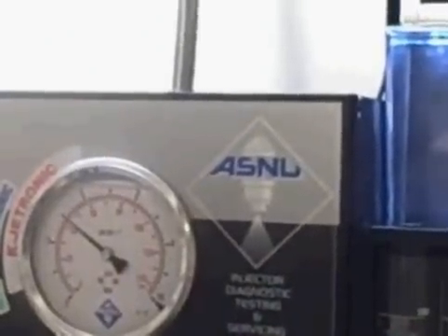There's your pressure at 43 and a half. Next we're gonna run it again and start running the pressures up — we're gonna go up to about 55, 60, 80, 100, 120, and 140. Now I know nobody's running 140 psi in their fuel pressure, but this will show you how strong these different types of injectors are.